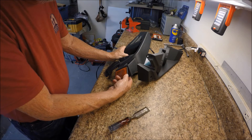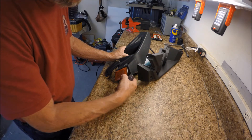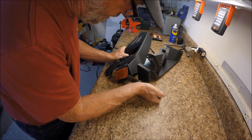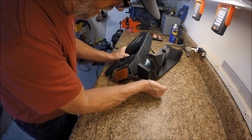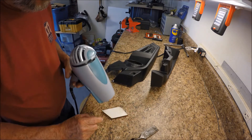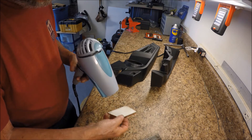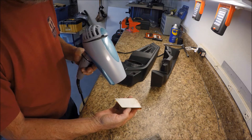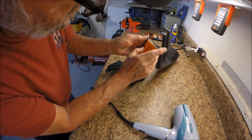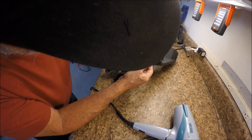As you're heating up the back of the reflector with the hair dryer and it's getting hot, go around and you'll find an edge where you can get behind the adhesive and the cover mount — right in here like that. It's a slow process, don't rush it too hard. Once it's off, heat the new cover up good and stick the reflector back on, making sure you've got the right edges all lined up. There's only one correct way, and there it is.